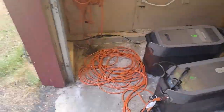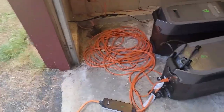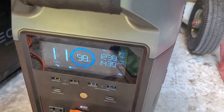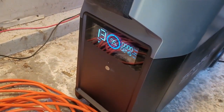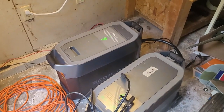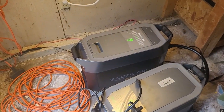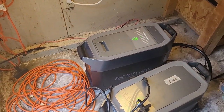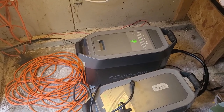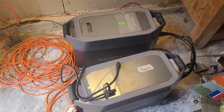I've got a kilowatt coming in and 1.4 kilowatt hours going out to the car. I'm at 98 percent on the main unit and 95 percent on the extra battery right now. When it runs it tries to keep them roughly the same. It doesn't shift power back and forth because every time it moves power around there's a loss through the inverter and cabling. It tries to keep them within about 10 percent of each other but doesn't try to make them exactly equal.